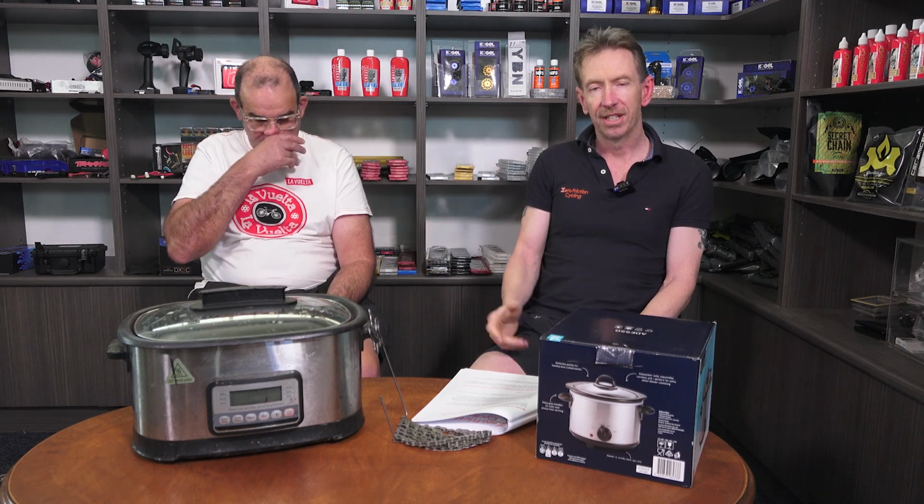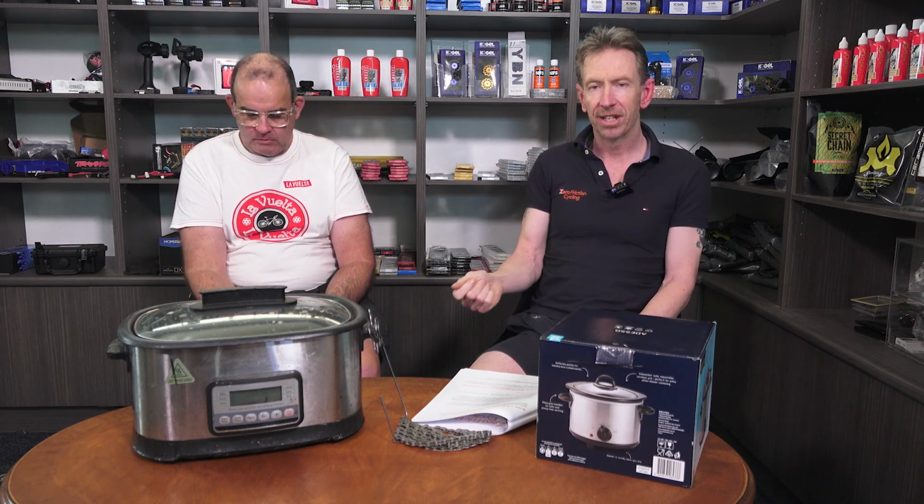So my roundabout way of getting to this one: if you're on a wax chain and you've hopefully not got a massive amount to go, Silca SS Drip is a great one. Same as True Tension, same as UFO, just quickly throw that on top of the chain and go. You should be able to do a relube in about 20 seconds and set off again.